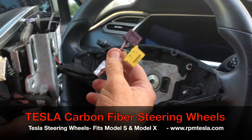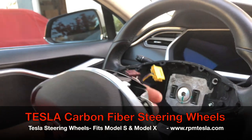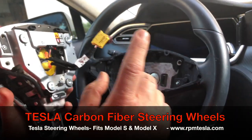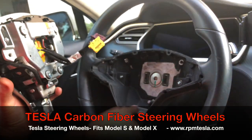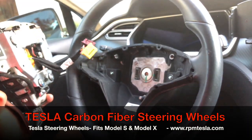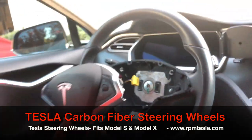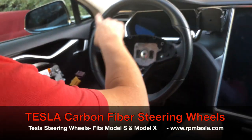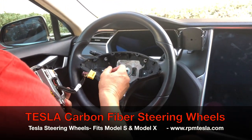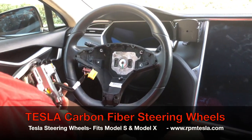This is your airbag. Each of these cords are required for the electrical system to work on the switches in your airbag. This is a very important part: if you find one more wire in here, it means you have the hot/cold weather package, which means your steering wheel is completely heated all the way around. If you do have a wire here and it is connected, pinch it, squeeze it, disconnect it. You're going to hook it up to your steering wheel and you're going to have a heated steering wheel.